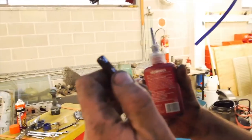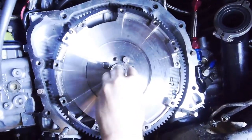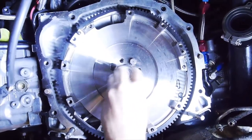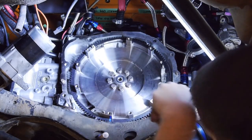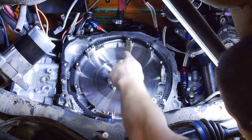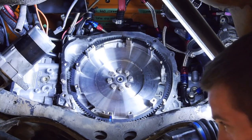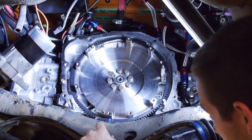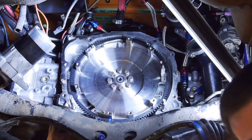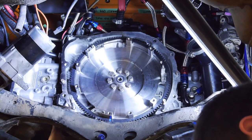The four I've got in there are already loose, just to locate it. We'll get all these started and then tighten them up. So I've hand tightened all these, they're all reasonably tight. Your pattern has to be crosses. Ben has taught me well - he's got me onto the paint marker method. We mark each bolt after we do it so we know that we've done it. The manual says gradually tighten them up to 75Nm, so I'll set it to go 40Nm first.